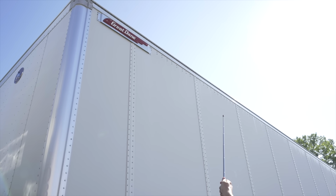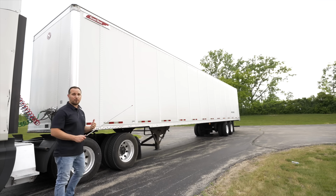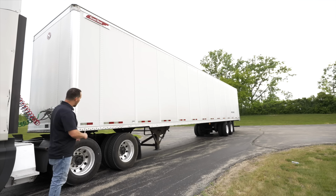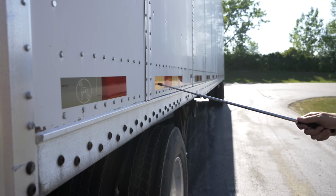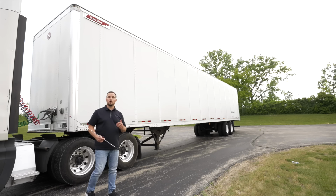to back. I would check all my clearance lights, make sure they're not broken, not cracked, on secure. They're all proper color and functioning. They function as running lights. Then I would do all my DOT reflective tape on the side of the trailer, make sure it's clean and clear, the proper amount. After that, we're going to move down to our landing gear.